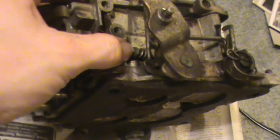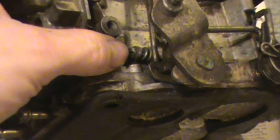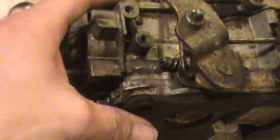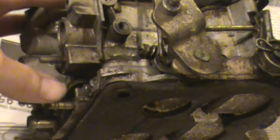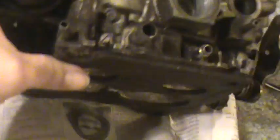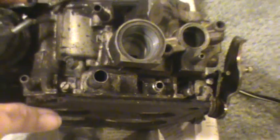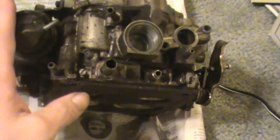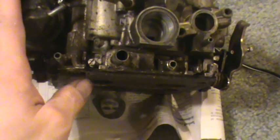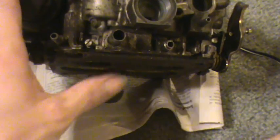Just keep that in mind: your whole goal with this is to get the engine's manifold vacuum and idle speed the highest. Now, what's going to happen is you may have to come over to your idle speed screw afterward. You may be idling so high at that point — it may have been so out of whack — that you'll have to readjust your base idle speed. You might have to go down with it some. You shouldn't ever have to raise it, because if it's already too low, the only thing it's going to do is idle faster. But that's the quick and dirty how-to on this — there's really nothing to it. They're always going to be very, very down low on the carburetor, on the base plate, because they're the last junction before that air mixture gets sucked into the engine.